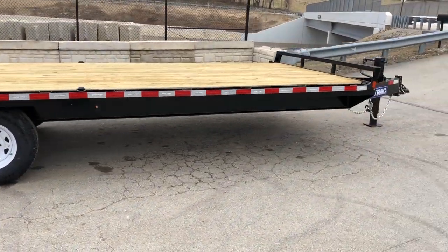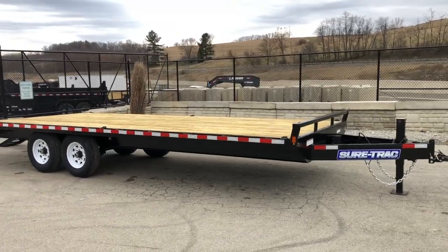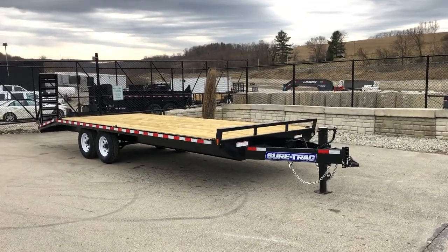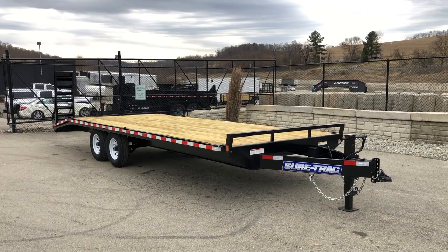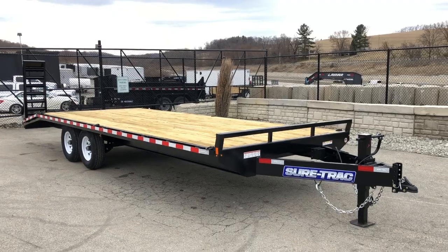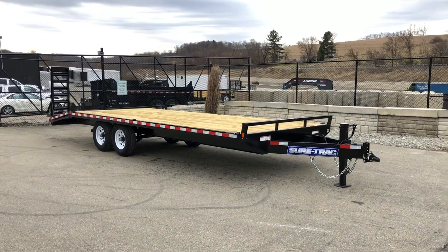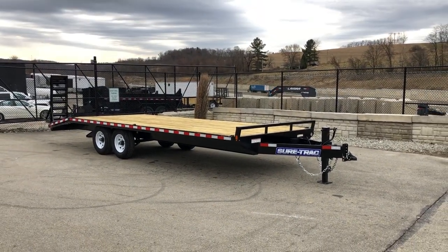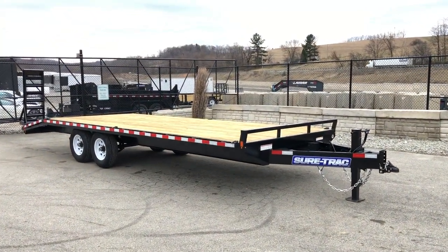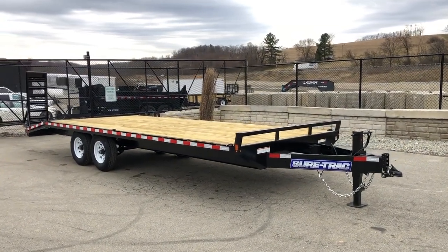With this weighing in the low fours, you're going to have just under 10,000 pounds of net legal payload plus your tongue weight. Tongue weight is generally going to be about 2,000 pounds. The payload equation for this would be 14,000 minus the empty weight, giving you about mid-nines. We like to keep you on the safe side and use 10 percent for tongue weight so your axles are still generally legal. Safe-side payload is going to be upper 10s to 11,000 pounds on this, depending on how you load it and what your final tongue weight percentage is.